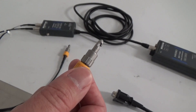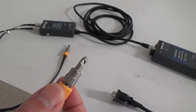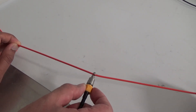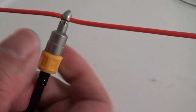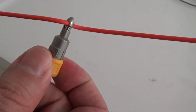If you turn the yellow part of the probe in this way, the hook opens up. Attach this hook onto the CAN bus. By turning it clockwise, you can pinch the sensor securely onto the cable. It will stop spinning when the probe hits the cable. You can't damage the cable by turning it too tight, so make sure you turn it firmly until it stops.